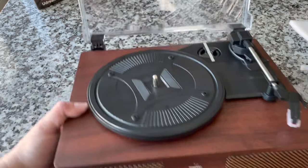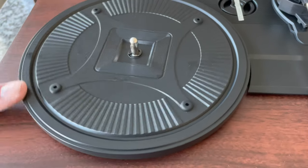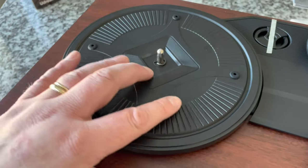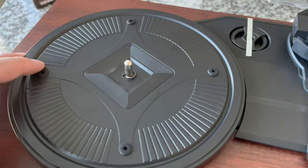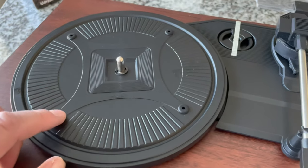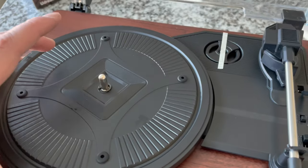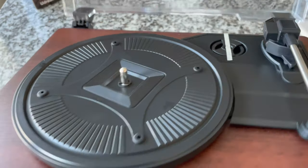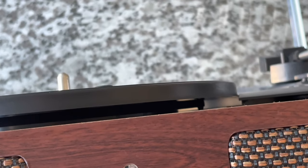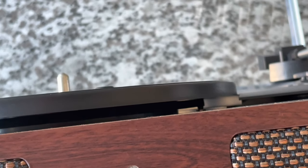The platter is plastic — this is the Skywind type of mechanism, or a variant therein. I've never seen one with this exact pattern on it, though. Four points of contact, which is odd; usually there are three rubber nubs for the record to rest on. It does have an E-clip, and it is inevitably belt-driven. You can see the belt coming off the subplatter to the right onto the motor assembly and spindle.